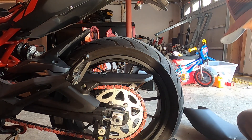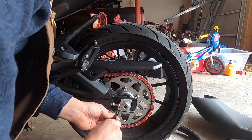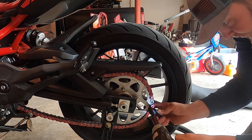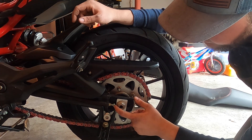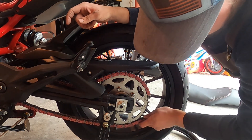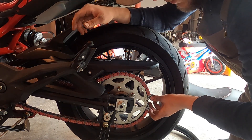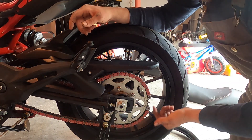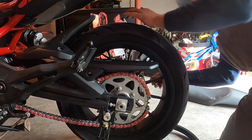That's a problem. I hope I didn't mess this up. I'm only human — I'm going to make mistakes. I kind of forgot about chain stretch — you have adjustments. I can pull these in; these are my adjusters. I can sit here and tighten this up until that link sits properly. It's going to push it in when you use a shorter chain. There's another adjustment on the other side, so you're going to have to do both of them.